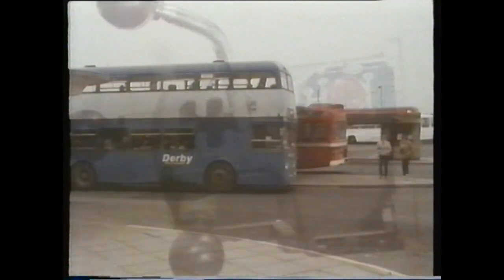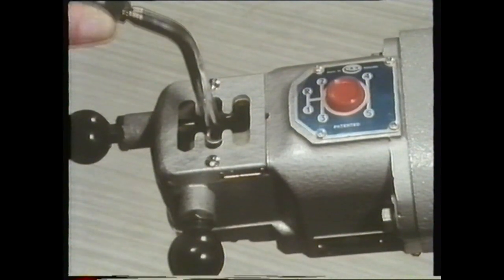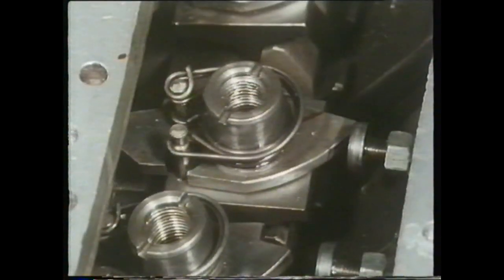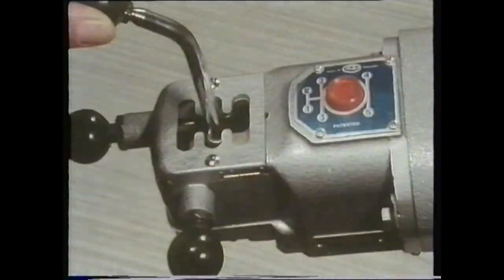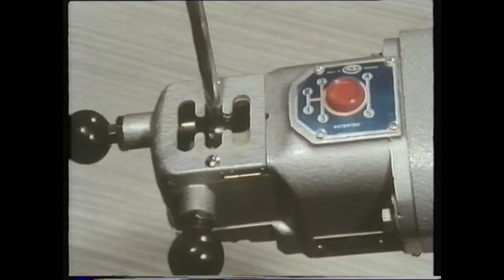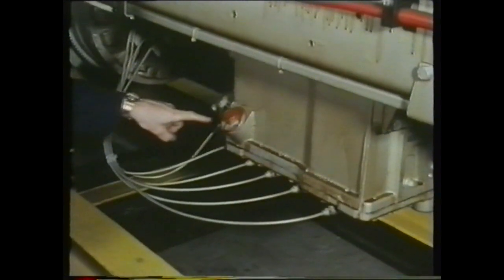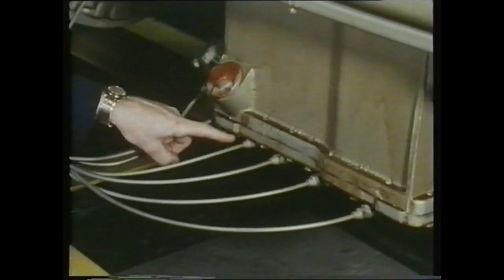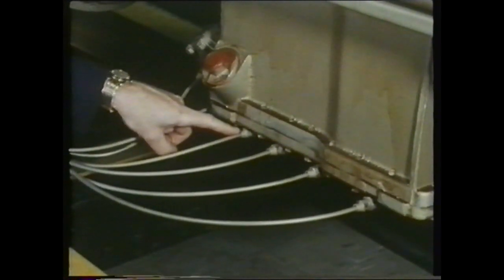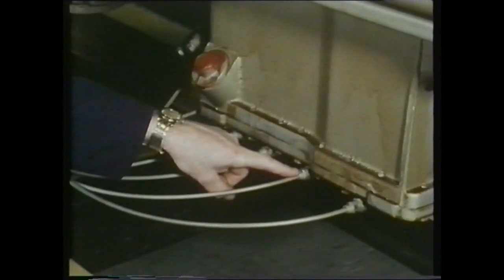As an example, assume that a vehicle on its return to the depot is reported to have a condition of no drive in second gear. The first check should be made here: toggle the gearbox brake band by engaging the gear approximately twelve times, pausing briefly between applications, or the correct adjustment will not take place. If the problem is simply one of adjustment, this toggling exercise may correct the no drive or slip condition. This is the point where the air pipes from the EP unit enter the gearbox, and it's here that you can establish whether a fault condition lies within the gearbox or in the change speed system.